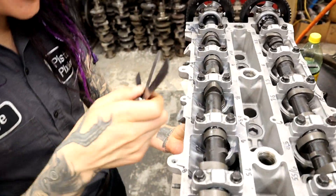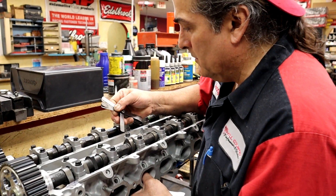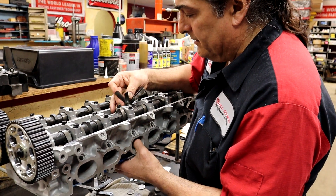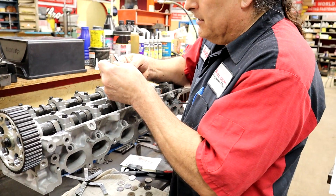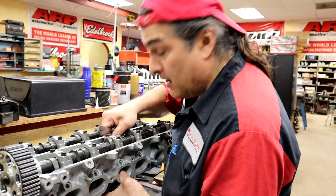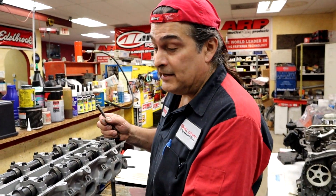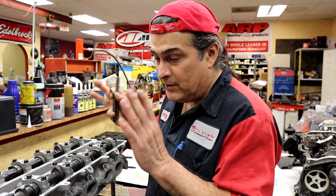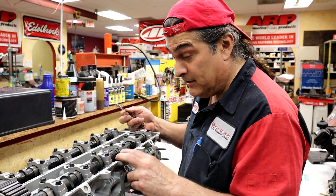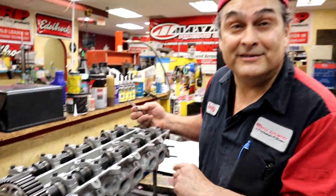I've got to calibrate the hands. The way I'll know is the seven will go in effortlessly, the nine won't go in, and then the eight — we can also just see how it feels. It's an eight! Can you imagine if you were doing all of these in a car? That's why they give you a window — everybody's going to try to hit that window so the valve's not too tight and you're not burning out the intake or exhaust, and it's not too loose making noise. But getting them all just right is really going to make a difference. Now you only got a few more to go!